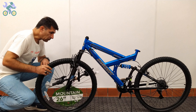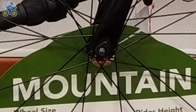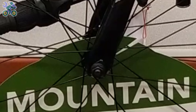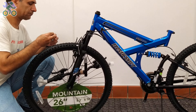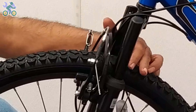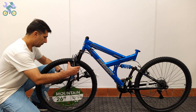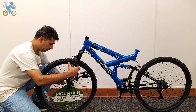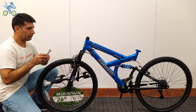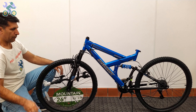If the fork was bent and you couldn't put the tire in, I've made a video on how to fix it with the link in the description. There is a hole at the end of the fork — insert the wheel retainer into the hole and tighten the head nut by hand. In some limited models, only washers are used for the wheel retainers. Repeat the same process on the other side. Align the wheel in the center of the fork, slightly tighten the head nut on one side, then the other, and finally tighten completely, checking alignment throughout.